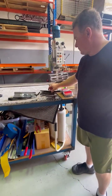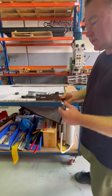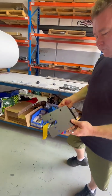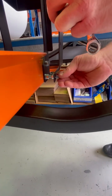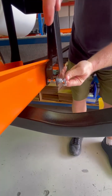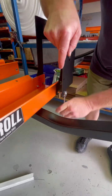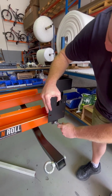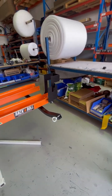With the light brackets there are two sizes: a smaller one and a larger one. The large one goes on the front tyre side because that's where you put your accessory number plate. Sit the bracket on, add another washer and the nylock, and tighten that up. Same — just get it straight and give it a nip. Same down this end.